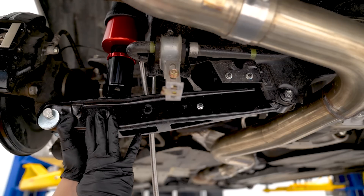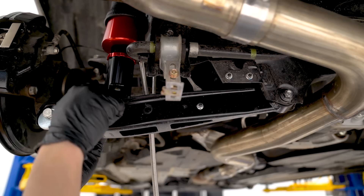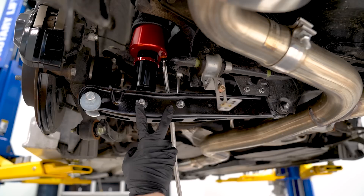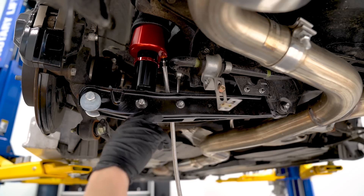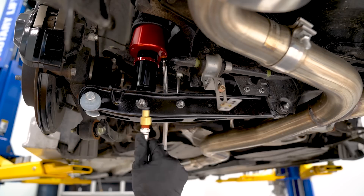For both the front and the rear, chances are you're going to need to put a jack underneath the lower control arm to lift it up a bit to get the holes aligned so you can get the bolts back in. Once all those bolts and nuts are reinstalled, go ahead and torque those down. I will leave the torque specs in the description, and then we can move ahead to routing the airline.